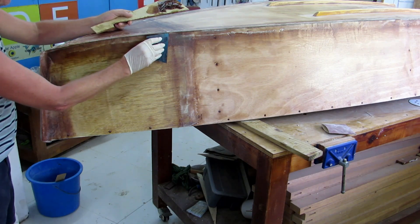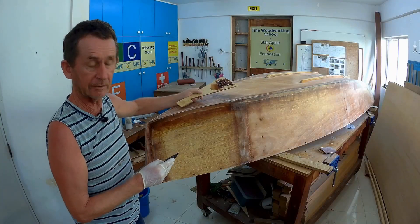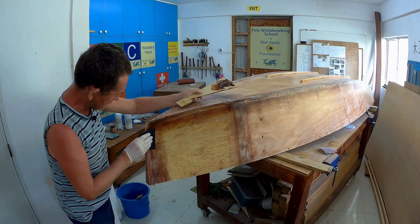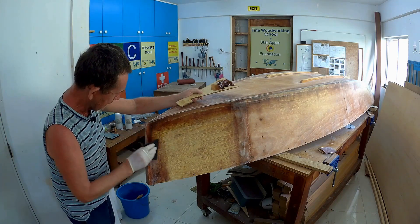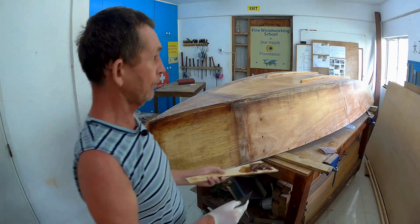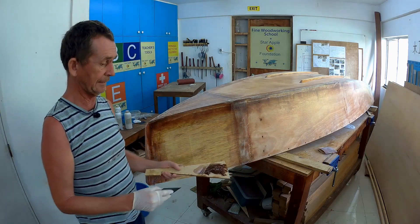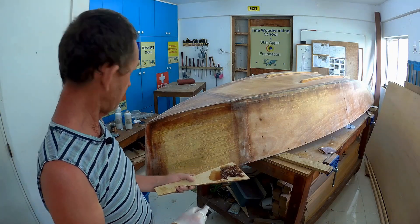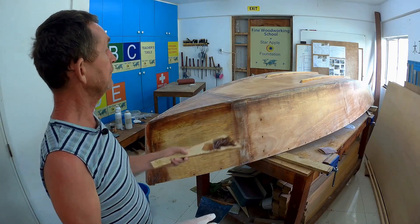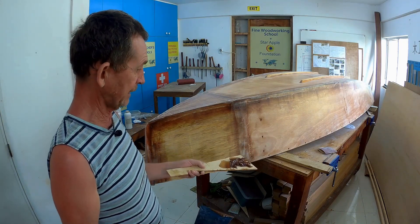It's much smoother this time. It's going to fill all the little ridges in the fiberglass — they're nearly all filled already from the first time — and we're going to curve this out nicely. I'm going to do that with the whole boat all over again. It won't take long; we'll mix small bits at a time because if you mix big bits you'll lose some of it and it's very expensive. I still have to put a fillet in the skeg — I didn't get around to doing that yet.